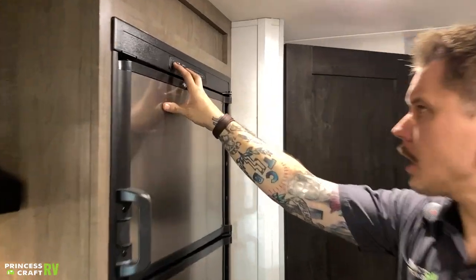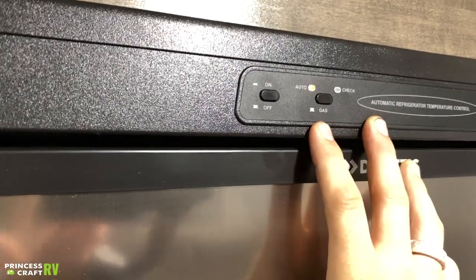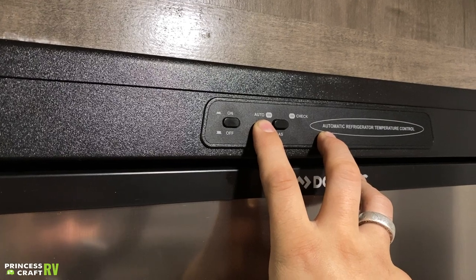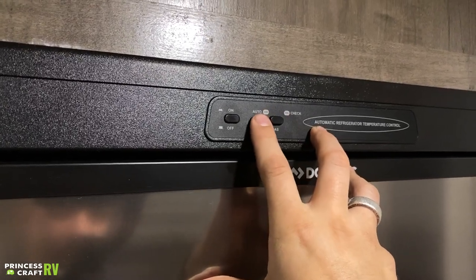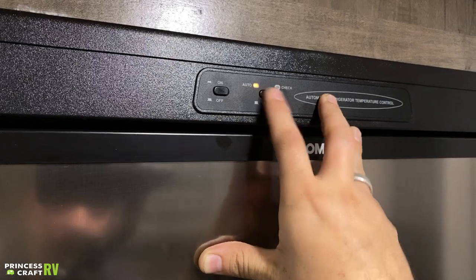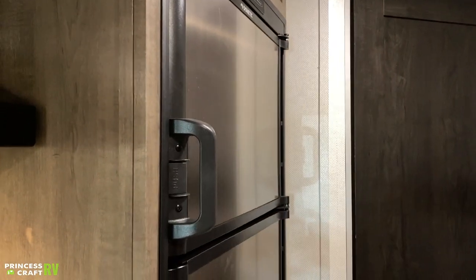We have your refrigerator here. We have your main on-off switch — it goes through kind of like a little boot-up procedure. From there, we have really just one mode button. Your standard operation is going to be in auto, denoted by that orange light there. If I depress that gas switch, that's going to send us into that gas mode. In auto mode, it defaults to AC voltage first. If it does not find AC voltage, it automatically switches and starts lighting off of gas. In standalone gas mode, there is no automatic switchover to electricity and no real indicator that you are running in gas mode other than the orientation of the switch. If it fails to light in that gas mode, it's going to illuminate this check light. It's a very basic, very easy system to use. We have these latch locks here — push on that button and that allows us to go ahead and open the doors.